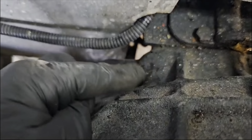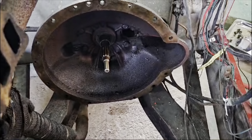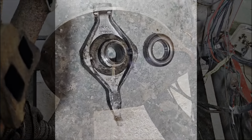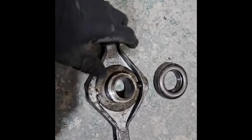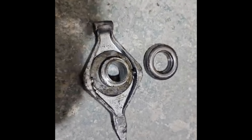The carrier's out. If you look at the top of the gearbox on the left-hand side, you'll see this hole here — I literally used a punch and a hammer and it was surprisingly easy to get out. Now the carrier's out, it's going to be a disassemble and rebuild. Here we have the old clutch release bearing and mount. Normally we'd use a puller but it didn't seem to have much resistance, so we used a piece of flat bar each side with a socket in the middle — tap tap tap and she just popped off.